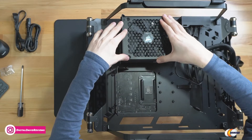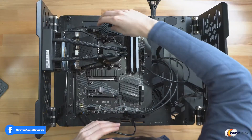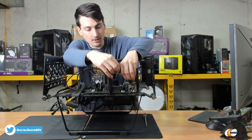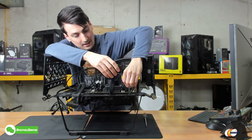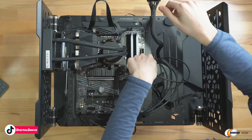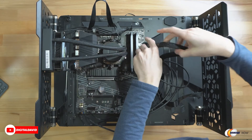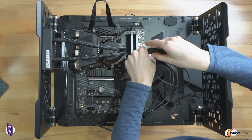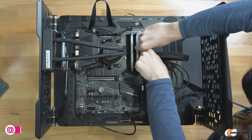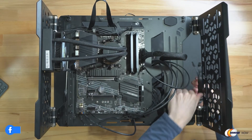Now we're going to get all four screws installed on the side to hold it in place. You can see it's now fastened in place and it's not going anywhere. Now we're going to flip it over and route our cables. First up on the power supply you can see the CPU cable — we're going to connect that right there on our board. Line everything up, gently press in place, and there we go — we just connected the power for our CPU. Now here's our main board connector — it's only going to go one way, and you can see the little clip.